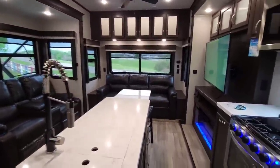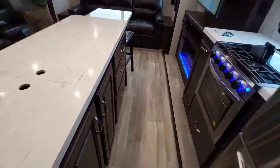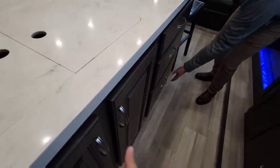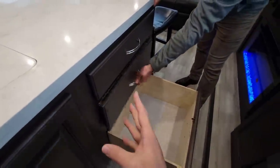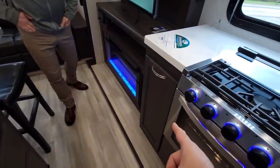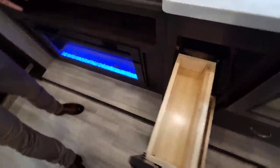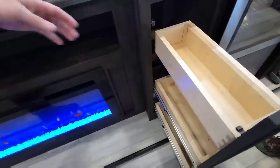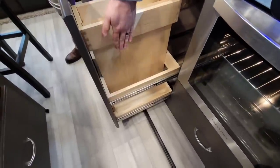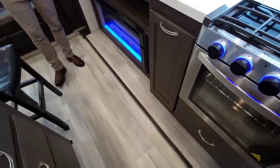Something unique: when we walked through the current 398 MBL, the cabinets were a little lower so you couldn't fit a large trash can. There were four drawers instead of three, so more pots and pans storage. We shifted the trash can across the aisle — this is a very unique feature we worked with the supplier on. Since JD does a lot of cooking, you've got a spice rack on one side and a spot for larger pans or cutting boards on the other, all on four ball-bearing roller glides. The larger drawers have 100-pound ball-bearing drawer guides; smaller drawers have 75-pound guides.